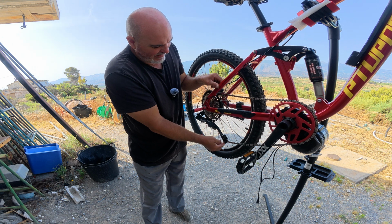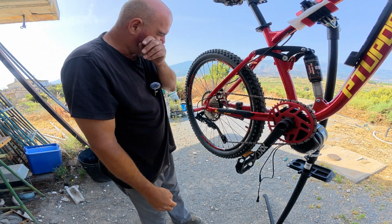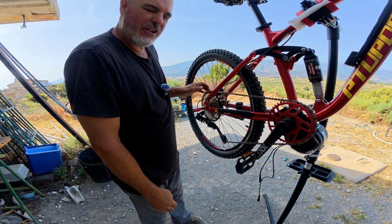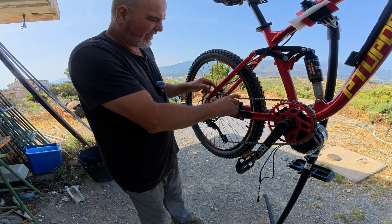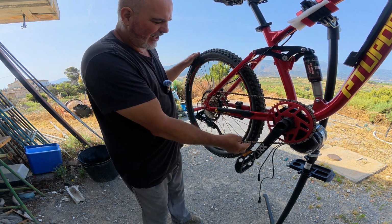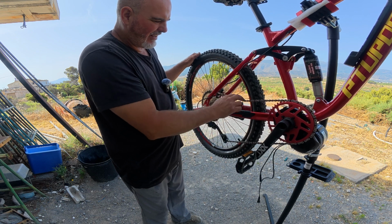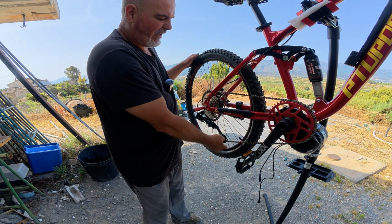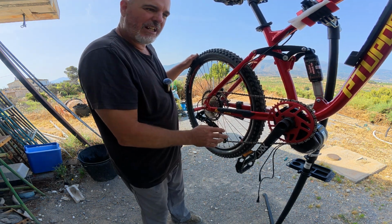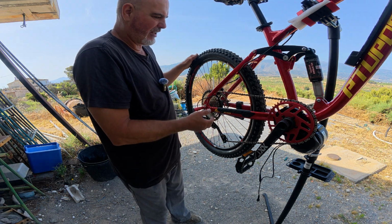And there's quite a bit of play, spring left in that. So I don't know what to do really. I think what I'm going to do is leave the standard chain on for now, give it a good ride and see what it's like. It still seems, like I say, to be plenty of slack in the chain. It's not like it's dead tight. I'll follow the rules that you normally do, the 2-link rule and that, and there's more than that in there. So I think for now I'm just going to leave it and carry on, and then if we need to make any adjustments later we will do.